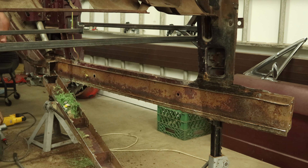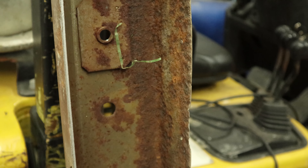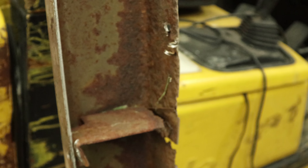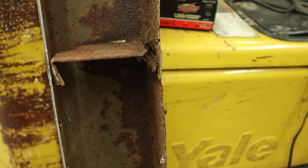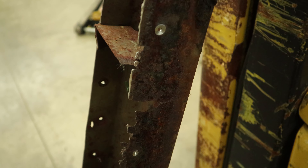Well, I was not expecting to find Easter egg basket filler in here. Looks like I had a tenant in this side too. So there's the inside of this frame rail — that's pretty thin, those pits are pretty bad at the bottom. And this is what led me to change all this. Actually some holes — that brace is completely gone. That was where the seat brace went across the bottom, so water collected in there. All the Easter basket filler was actually little pieces of a tarp that some rodent had collected and made a house out of. So I assume it was covered up at one point, probably because the top was bad, took in a bunch of water — and that's where all this rust came from. So much for a nice rust-free car I bought.